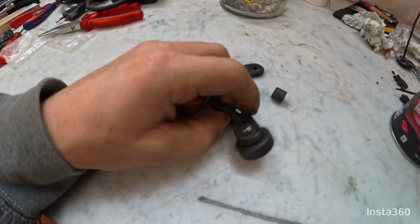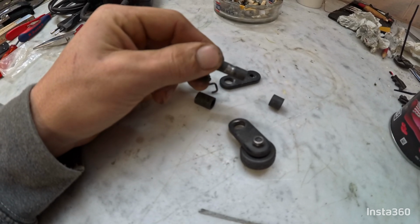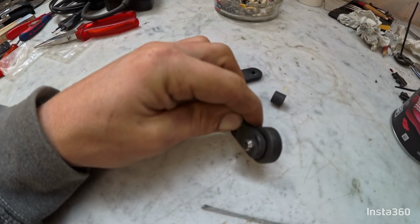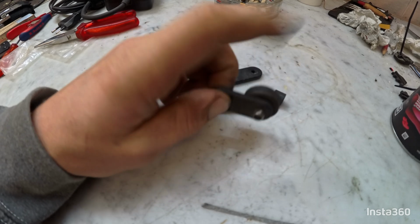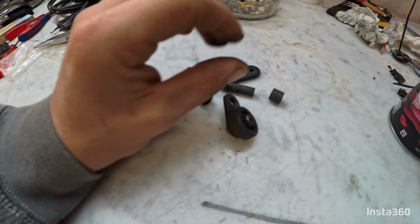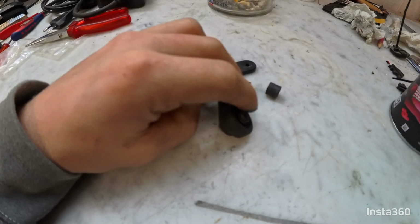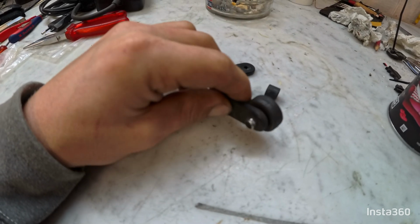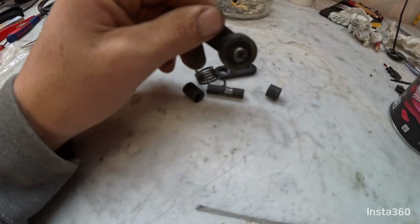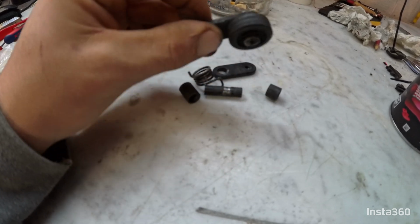I'm sorry, CYC, I really like your company, but the chain tensioner, you see it destroys itself, and then it gets off camber from the tension and destroys this bearing here, and it destroys also your chain, because the chain gets tensioned on one side only, and so it gets also, yeah, ruined. So actually the chain tensioner, I probably would always do my own.